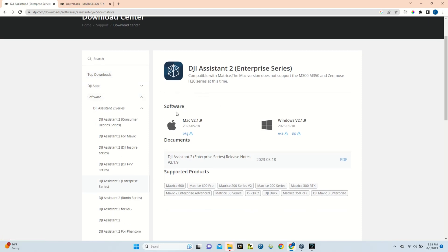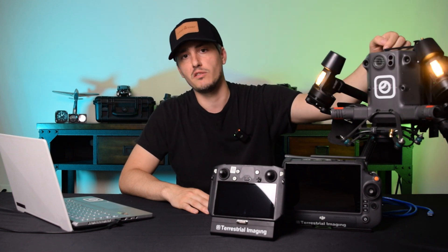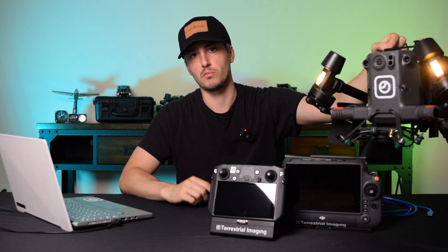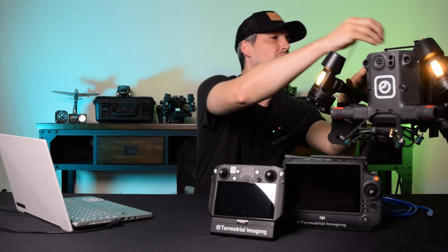Once you're done, you should see DJI Assistant 2 pop up. From here, what you're going to need is a USB-A to USB-C cable to plug the drone into the laptop. Turn on your drone, and looking at it from the front, on the left side there's a rubber USB port cover. Open it — there are two ports inside. Ignore the bigger one, open the rubber cover for the smaller port, and plug in your USB-C cable that's already connected to your computer.